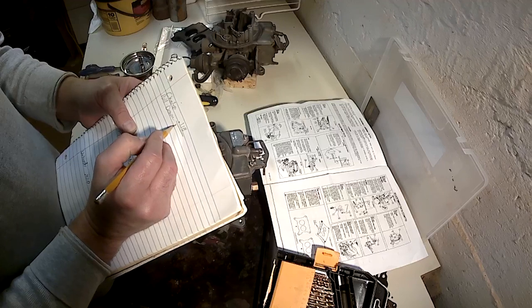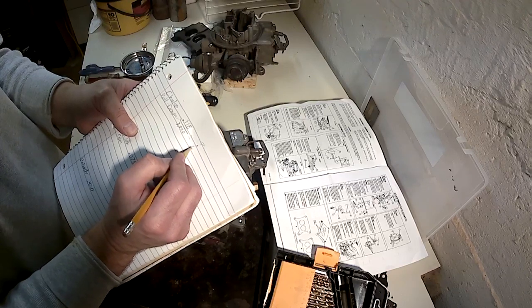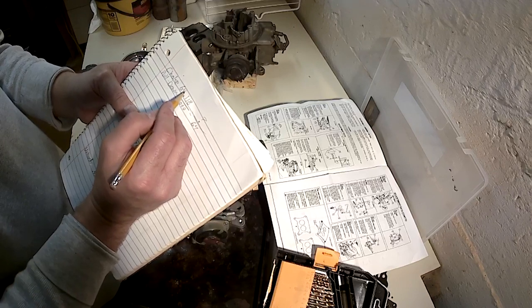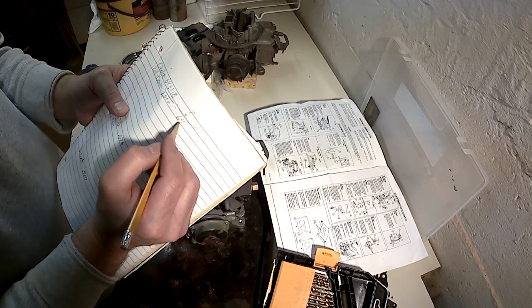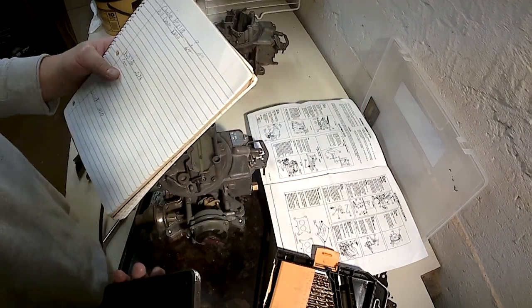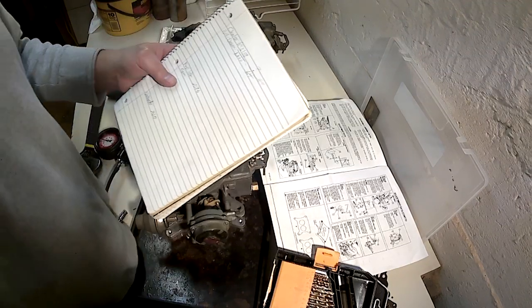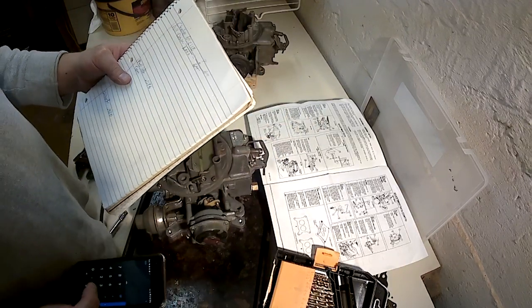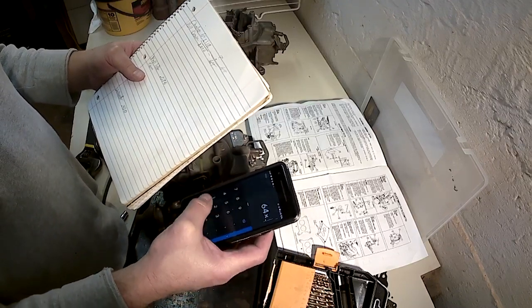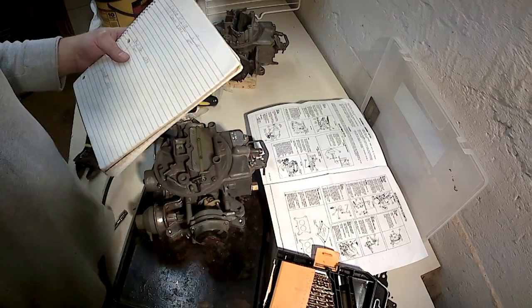Well, that's over 1 inch. It's going to equal something 64ths of an inch. And multiply both sides by 64. It's going to cancel that out. And I'll just have to multiply 64 times 0.118 to get my fraction of 64ths. So 64 times 0.118 equals 7.552 64ths.